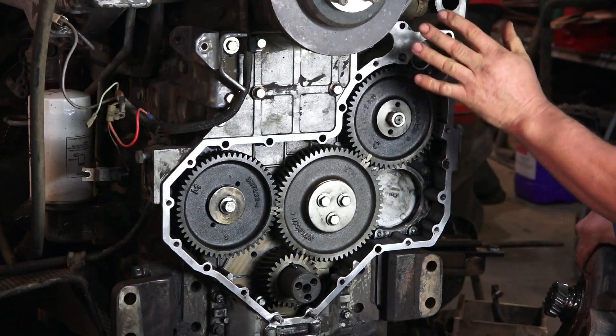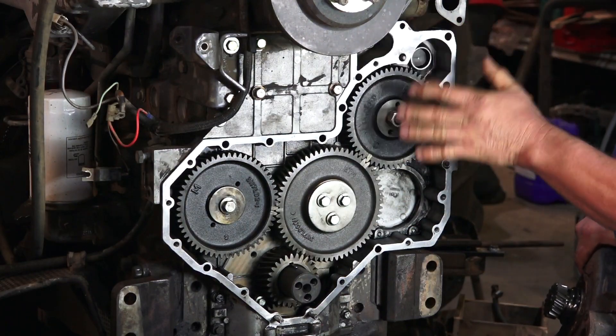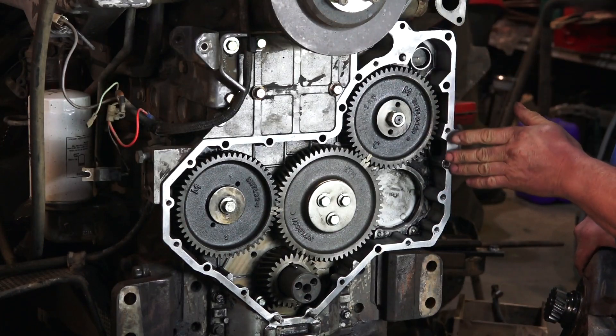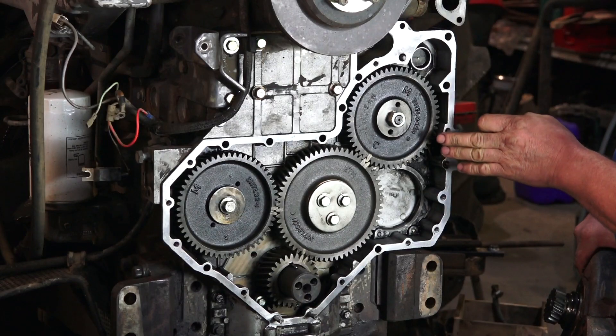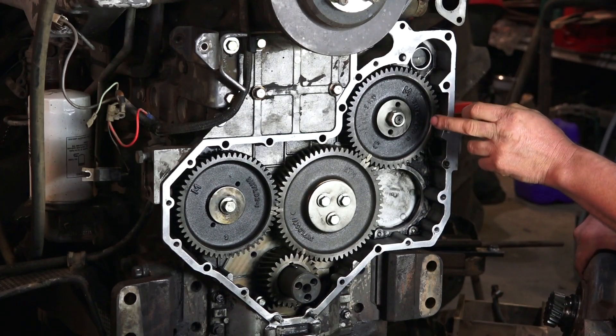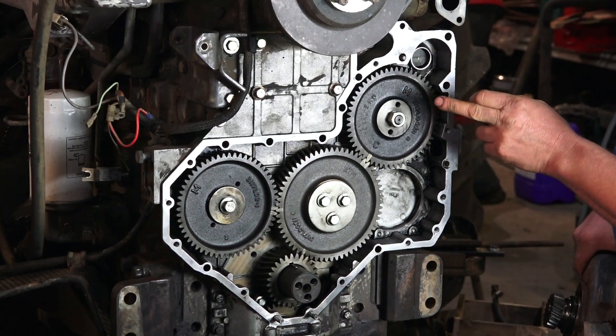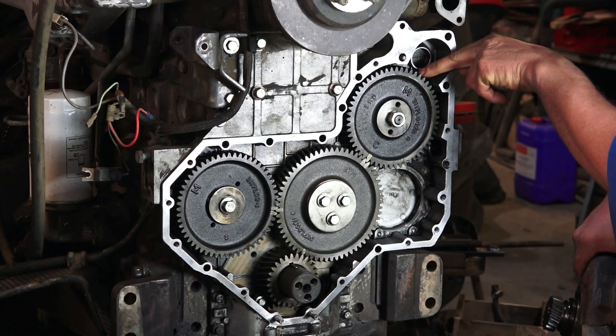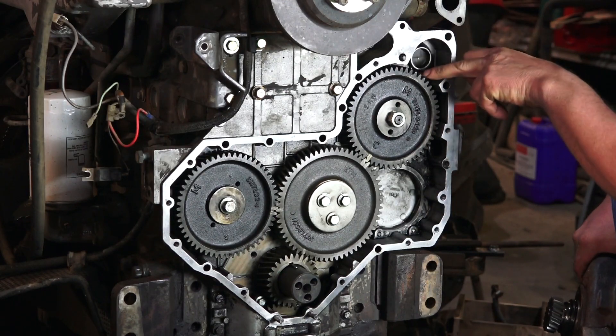So I've had all this apart, replaced the gasket and put it back together. But now we've got to put the cover on, we need to follow the correct procedure to make sure we get this seal concentric with the shaft and the pulley, and at the same time we need to set the gap between the water pump drive and the gear here on the injector pump.